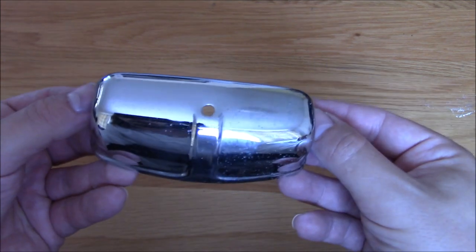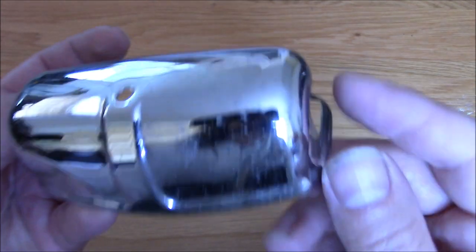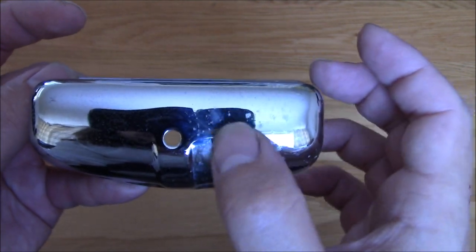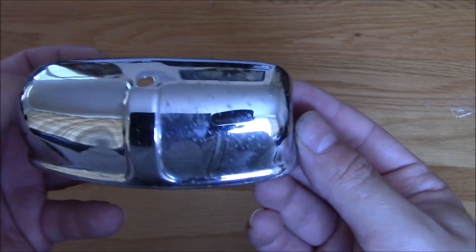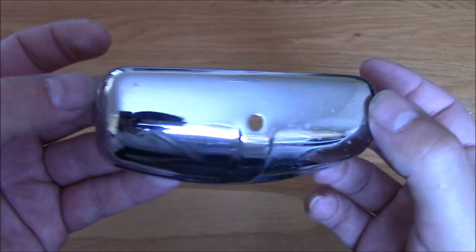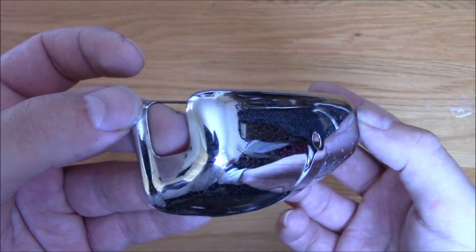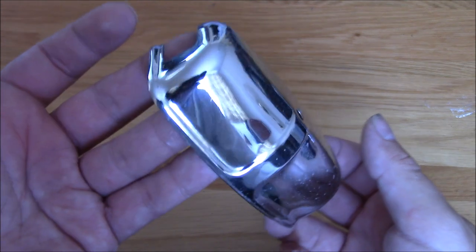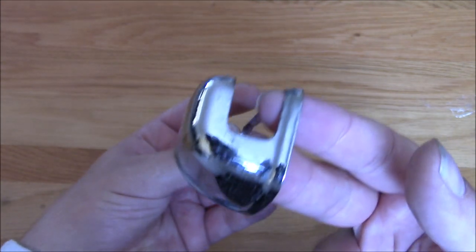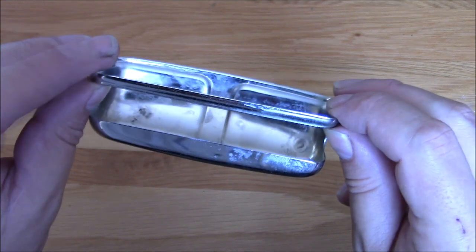This is the number plate light — it's come up much better than I expected. I thought it was going to be quite badly pitted. This side is just through the ultrasonic cleaner, so you can see what it leaves behind — just a few marks which I thought might be pitting, plus a bit of finger-mark-looking marks. If I kept putting it through the ultrasonic cleaner it probably would have removed all of that, but at this stage it's a little bit quicker to just polish it. I'm using regular Autosol. You can see the slight pitting and corrosion from it being a very old component, but it's come up remarkably well. I'll polish the other side and from the distance most people will view this, it will look like a really excellent piece.